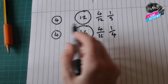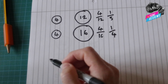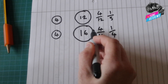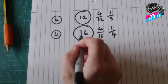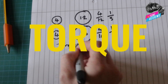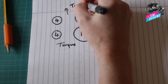But what does that actually mean? Well, with the larger rear sprocket in relation to the front — an increased tooth count on the back over the front — the bike is going to be more torquey. You'll have increased torque. However, the bike will have less top-end, high-end power, so lower top-end cruising speed.